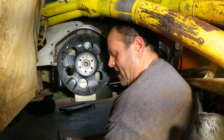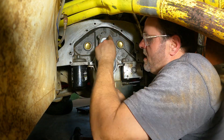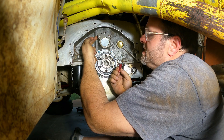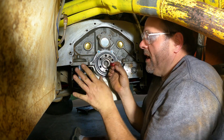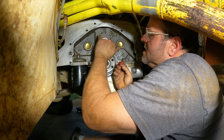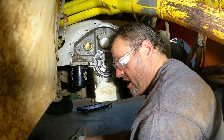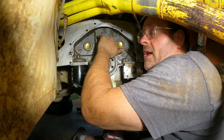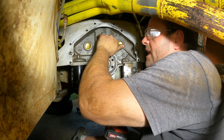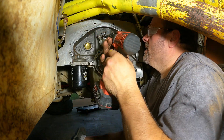There it comes. Oh, that's hot — rubbed up against my leg. All right. So this plug right here is going in that hole and that hole right there. But this plug's deep inset in there, and the shoulder right there — that's not going to work. What I'm going to do is just take some of that shoulder off on that block where the plug will sit down and tighten up where I need it to, and it will work just fine. I'm going to take a three-quarter inch drill bit. I left the plug in there because I don't want any metal to get in my oil galley or into my bearings, so I'm just going to drill this outside shoulder and then take the plug out so I won't have any metal in there.